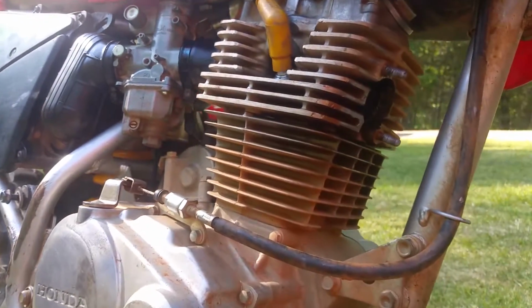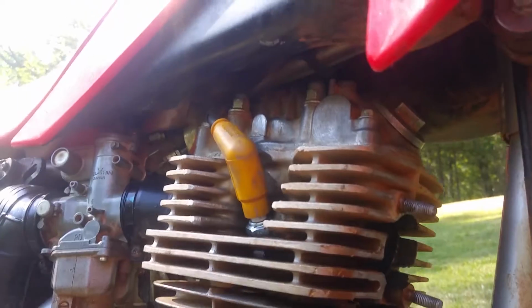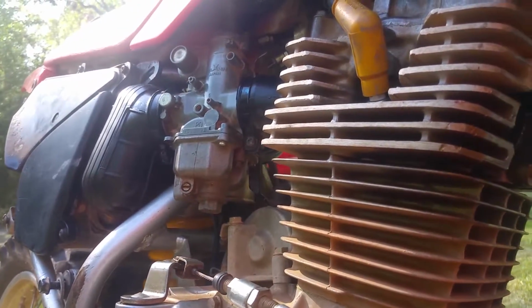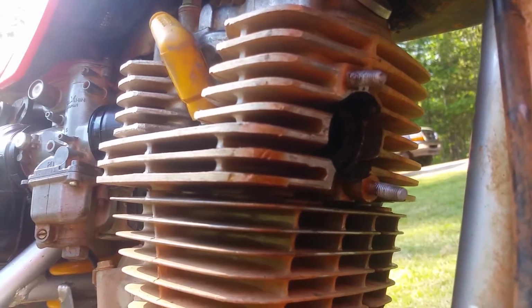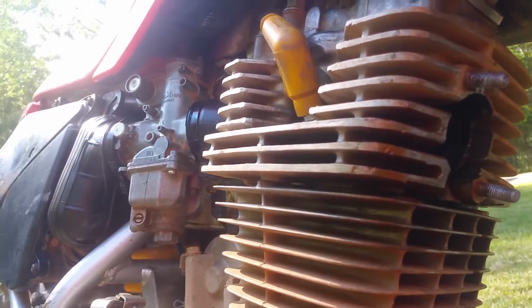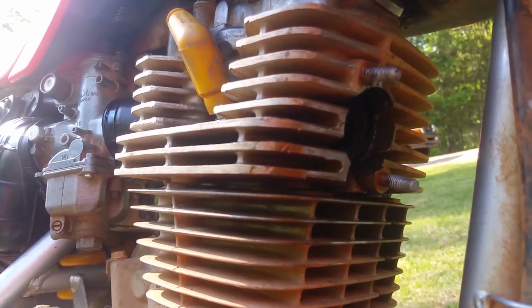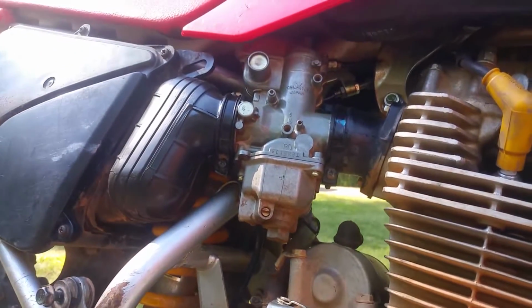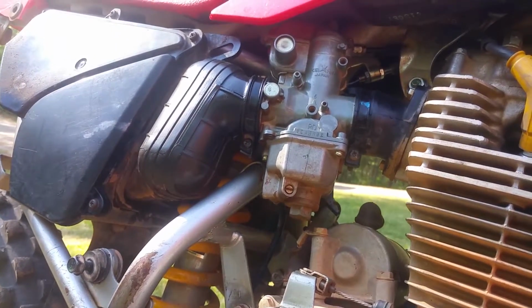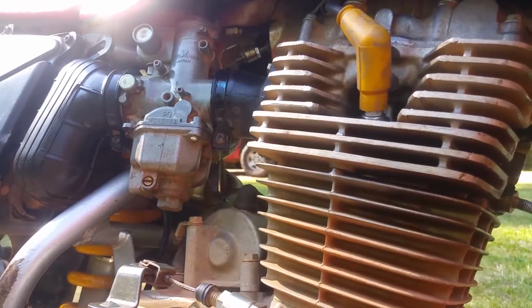You know, I don't have a lot of faith in these chemical cleaner type, you know, put this in your motor and bring it back to normal. I'm of the mindset, you know, take the thing apart, wire wheel it, make sure it's jetted right so you don't get carbon buildup, or just say to heck with it and leave it alone. But yeah, it's jetted right, everything's jetted right, so I might go back and fine-tune the jetting or something like that.